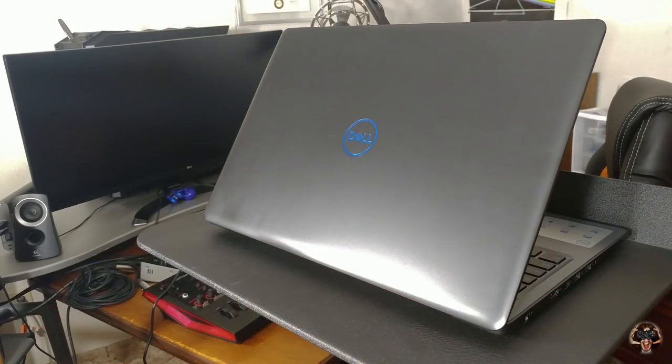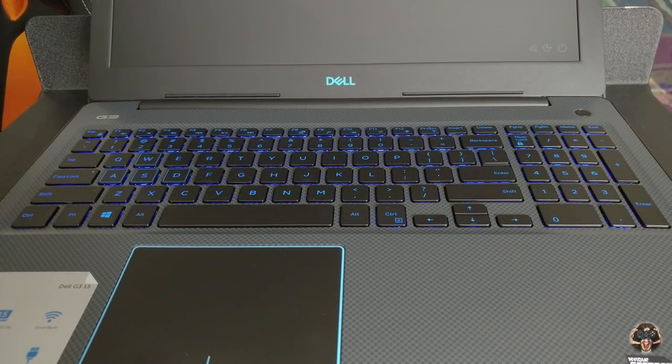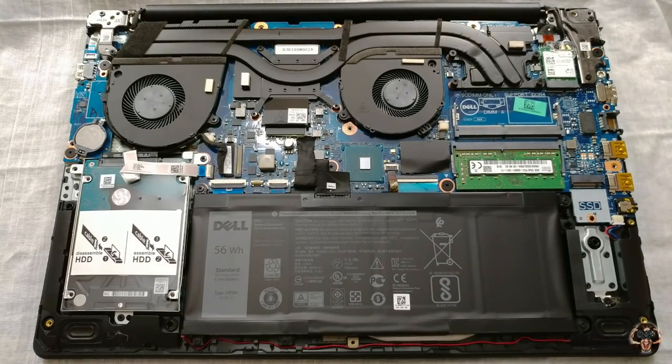The top is plastic with a matte finish that gets dirty rather easily — you won't see fingerprints but oil stains are obvious. The Chrome Dell logo is blue in most light and shifts to blue-green under the right conditions. The super smooth plastic trim around the keyboard hides oil stains much better thanks to the gray color, but it's not invincible. The keyboard keys and touchpad finish is not smooth to the touch and will wear over time. The body of the notebook is very rigid overall with little flex even in the display, thanks to the gargantuan center hinge. Removing the bottom cover is tedious but manageable — eight screws are removable and two will unscrew but not come out. A prying tool is recommended, and after removing and replacing the cover several times there hasn't been a lick of damage.